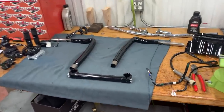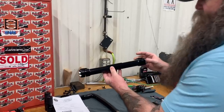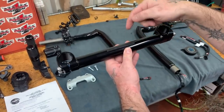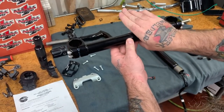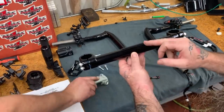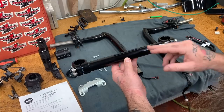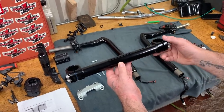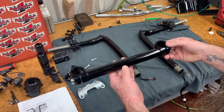So on these particular bars, they actually have a rubber underneath, and we'll look at that right here. Chad was showing me earlier. What they've got here, and these are the Spearheads by KST, just to let you know, we were talking about knocking that pin out, so the pin will be underneath and it'll knock out. Then they've got this rubber that squeezes down and puts pressure in there. As we were looking at the instructions, they said after 700 miles you need to retorque this. So that's something you can think about as well. If you install these, you'll have to knock that pin out. You do have to do some extensions here, and that's what we're getting into right now. But we did want to take the time and show you guys this.